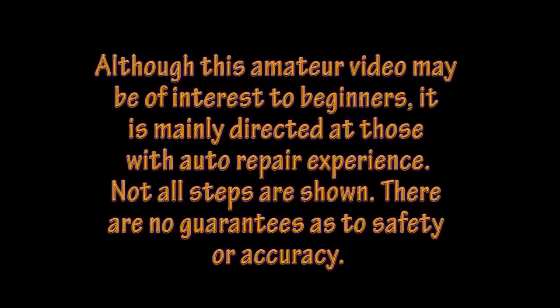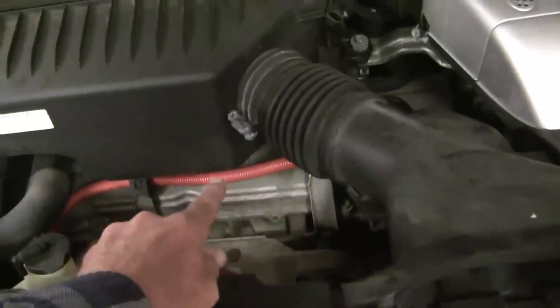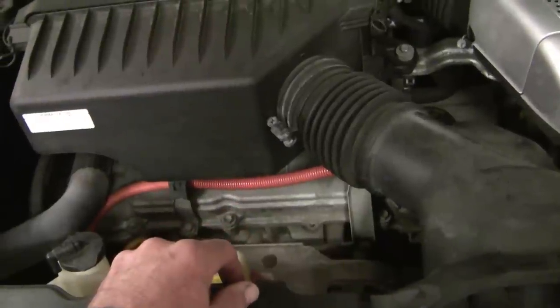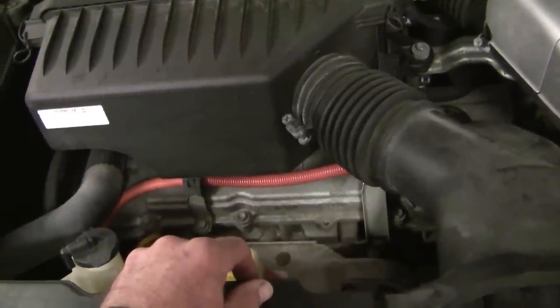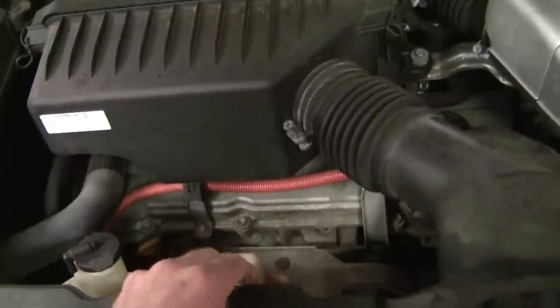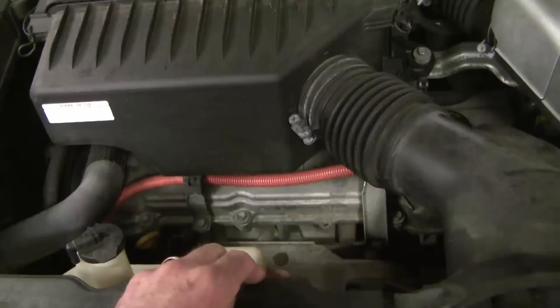This is a hybrid vehicle and there are some important issues with these hybrids that make repairs somewhat more complicated. I don't advertise myself as an expert in hybrid vehicles but one thing that's critically important is to know that these orange wires are 600 volt wires and they carry a significant reserve to certainly take away a person's life or cause major problems. Stay off the orange wires.